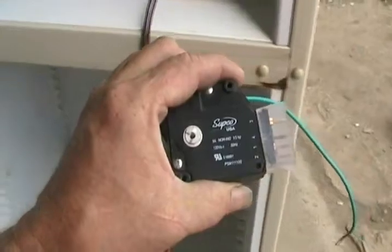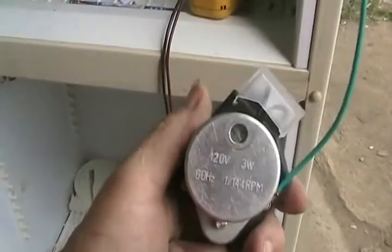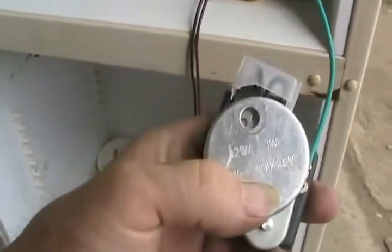It's not easy to test a timer with a meter because it's usually a mechanical problem. Very rarely the clock motor burns out. They usually just seize up. If they have this little window, you can see all those little holes rolling by while they're spinning.